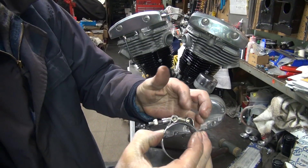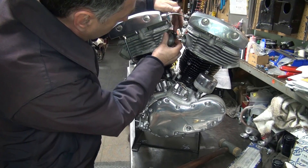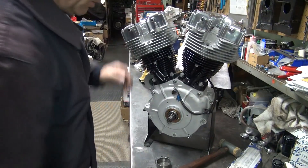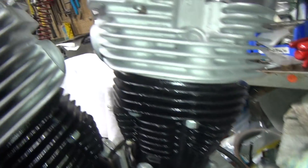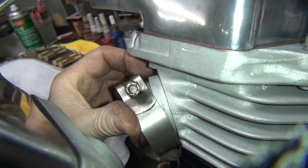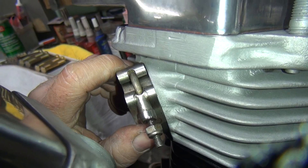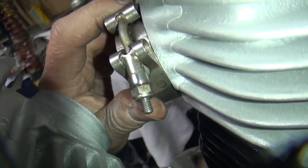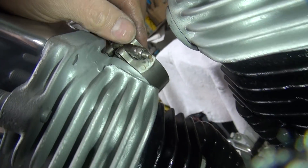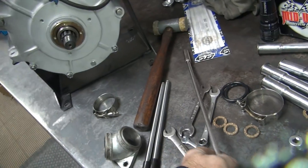The other problem is when you pinch this together, you get up into the fin up in here — underneath — so you only have just a little bit of clearance. You can't have it straight like that. You have to go around the other side here and rotate up until you hit something — that's as far as you can come up. So when you've got both clamps in here they hit each other and you can't tighten them. This one I always angle way down, and this one I leave angled up as far as I can get it. That's why I have the long wrench — I'm way down here so I can tighten up right here with a good angle.